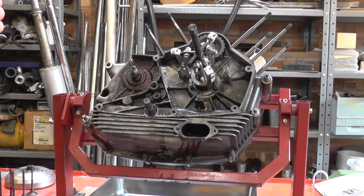So, you know, I've got to create a temperature differential between the pulley and the crankshaft, and obviously the pulley's cooling down whilst the crankshaft's heating up, and I'm losing the clearance I've generated with the heat. So I then have to let the whole thing cool down so that I can hit it with the heat again and create that difference.